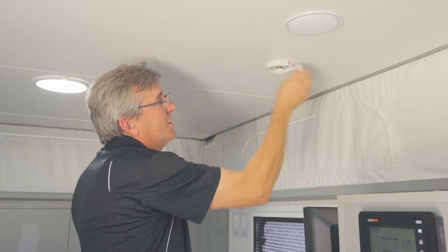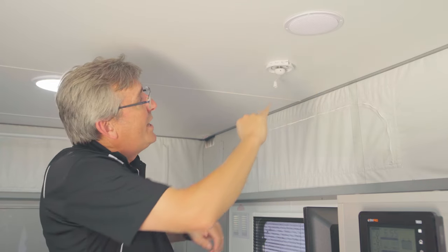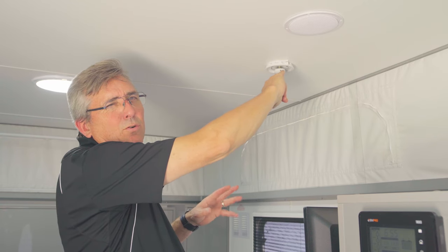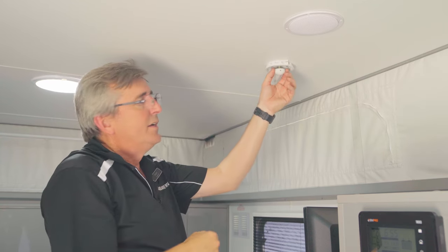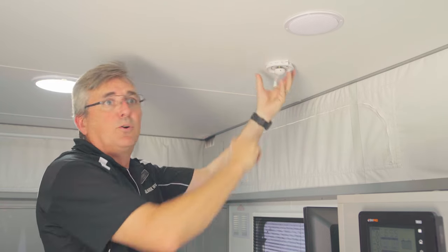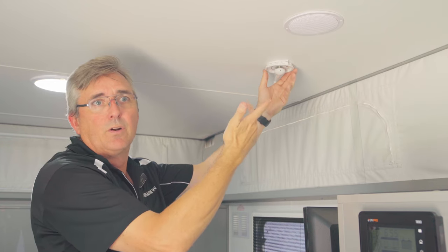It's the sort of thing that you always want to check before you leave that it's come down, and it's not a bad idea with this model to grab a little Allen key that fits that. It's either a 2 or 2.5 mil. In case the handle falls off in transit when you're bouncing down the unit out of track, you can put it all back together before you want to wind it up and watch TV.